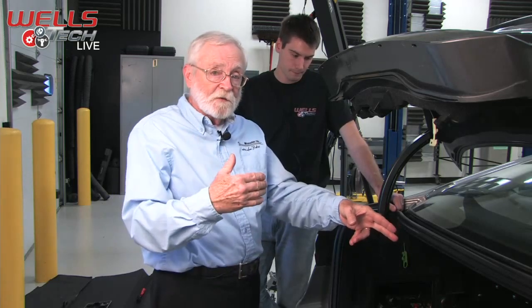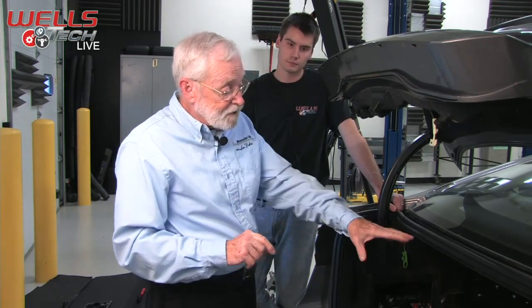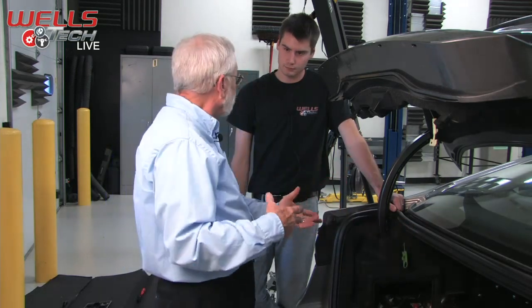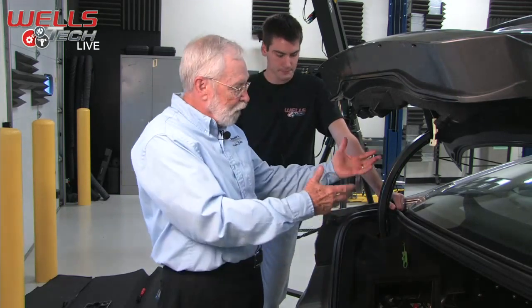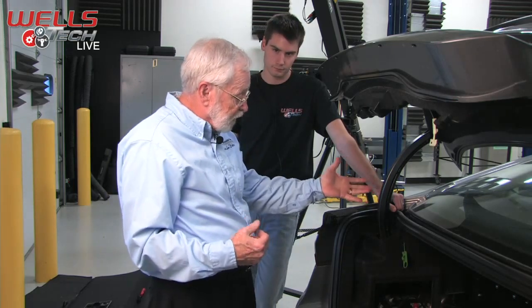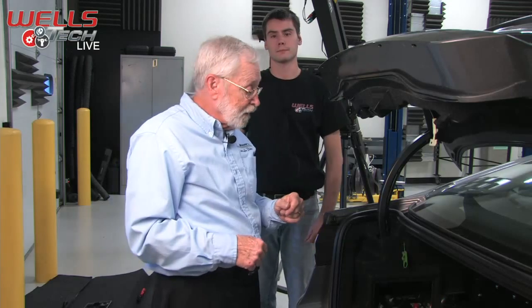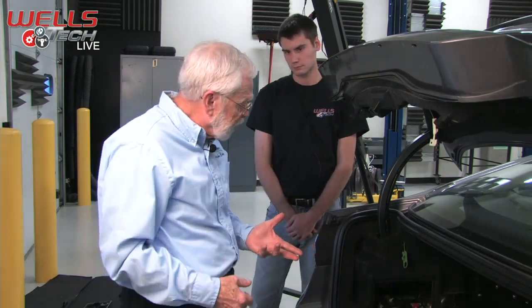So if we see the current flowing to the DC to DC converter, and we know that our turn-on terminals, our ignition and ground terminals, are okay, and the DC to DC converter has no output, then we know we need to service the DC to DC converter. So you can see it's kind of a three-step process. First of all, we're going to check battery SOC either up front or here. Then we're going to open up the door, and we're going to see it drop, showing our hookup is good. Then we're going to start the vehicle up and watch the current climb or not. And if it doesn't, we're going to move to the DC to DC converter's terminals to find out if it's okay. But in most situations, when you do this test, you're going to find that the vehicle's battery is just bad because it's old and grumpy and needs replacing.